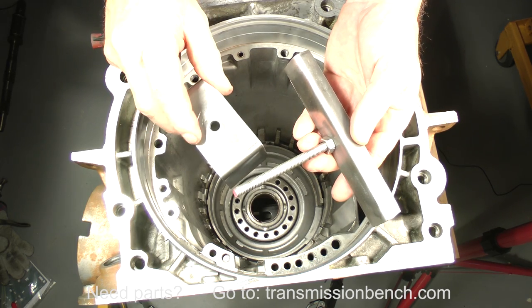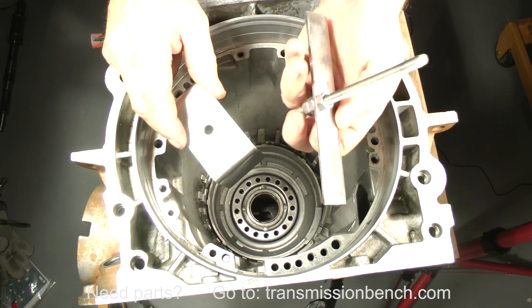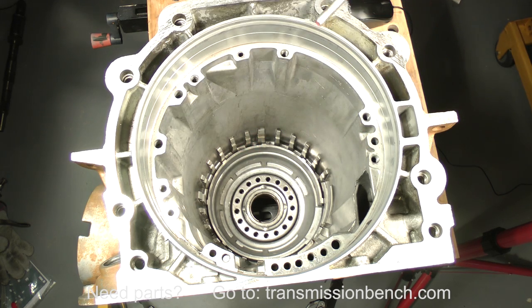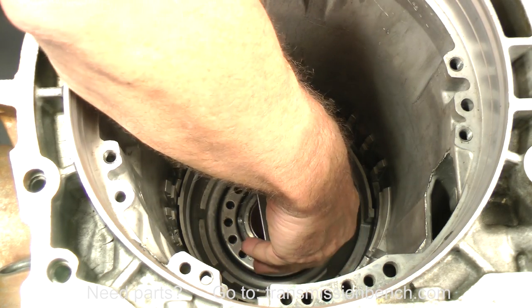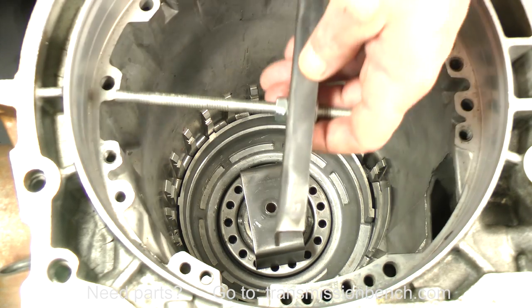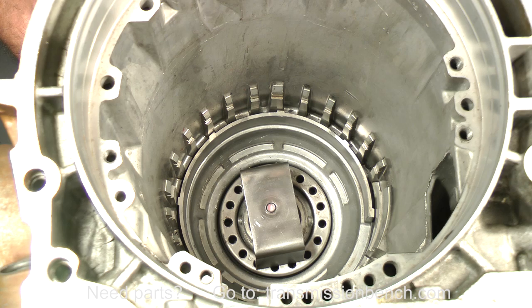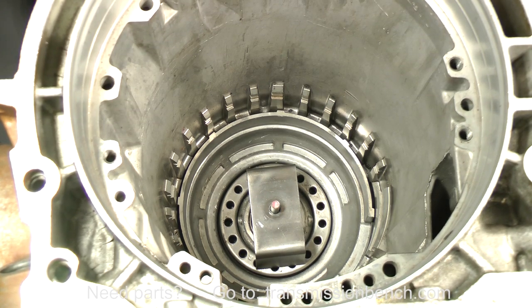It's simply a U-shaped piece of steel with a hole, a short length of threaded rod, and a few nuts and another straight piece. You can even make it from wood if you want to. Set the U-shaped part on the spring cage — notice how it straddles the snap ring, giving us enough room to work. Reach up through the output shaft hole with the threaded part, then start the butterfly nut and begin tightening.